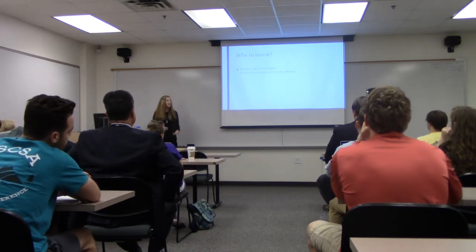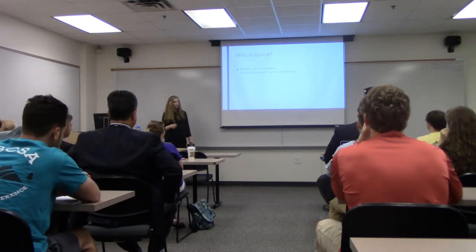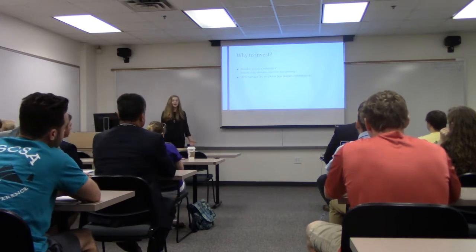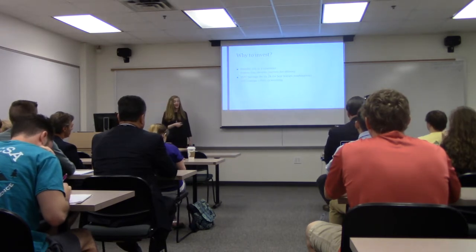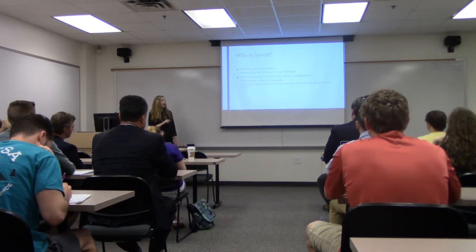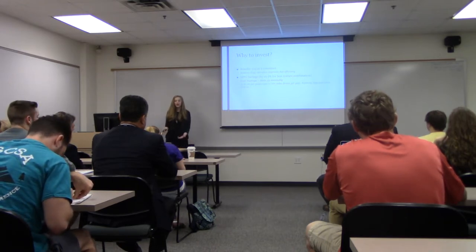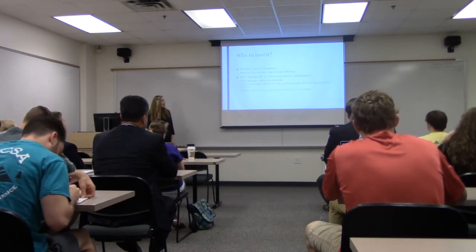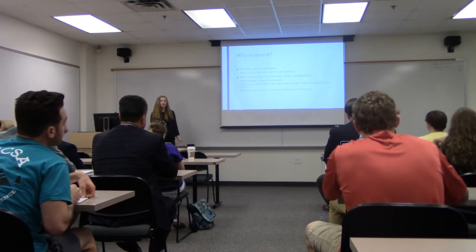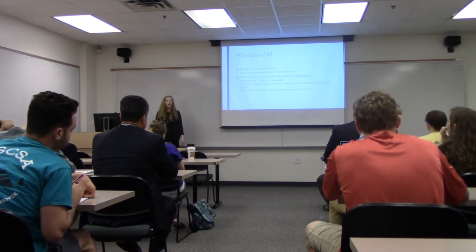So why should you invest? Basically, as a consumer, you would be reducing your drag and that improves fuel efficiency. So you would be saving money on your gasoline down the road. So the miles per gallon savings for the best feature combination at about 19.3%, so that's the all air dams, would be almost $300 saved annually. And that was done by using the price per gallon for premium gasoline, as well as driving 12,000 miles per year. And so the highway miles per gallon for the 2006 Range Rover Sport would go from 19 to about 22.7 miles per gallon. Now, if you value the all air dams at about $200, you would still save almost $90 your first year since buying the features, and then keep saving about $291 each subsequent year.